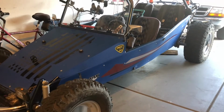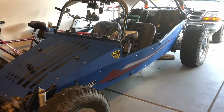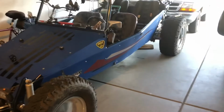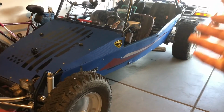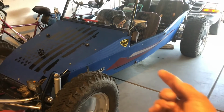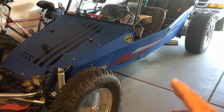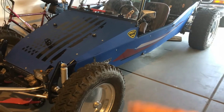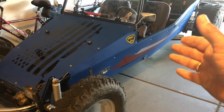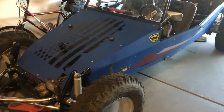If you don't, you're going to have to hit the stuff fast, and that's what I tried first. And when I was getting on her, it was just throwing all that horsepower and torque right into the tire and causing it to spin. And I didn't even get up to the good rock crawling rocks because I couldn't get the traction. So the next time, like I say, I just put it in first gear, got going, and then I crawled the rest of the way.